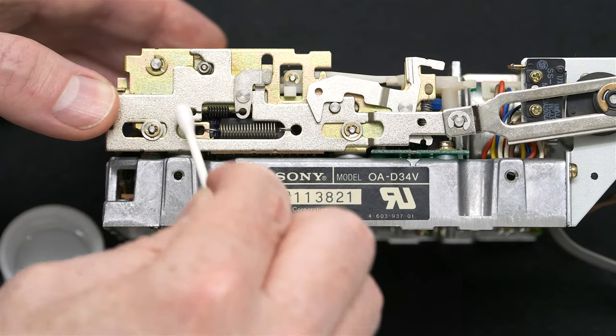Then put your PRAM battery door back in. By the way, make sure your battery is new. Don't leave it in there for more than 5 years or so. You can still find some of these if you're in the USA on Amazon. If you leave it in there too long, it will leak, and that will mess up your computer because that will flow down over the power switch area. You don't want that. So I just want to mention that.